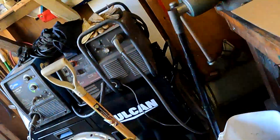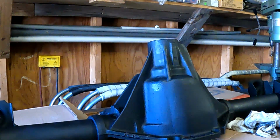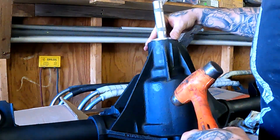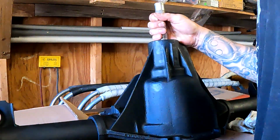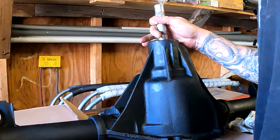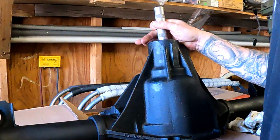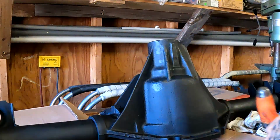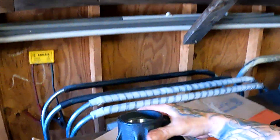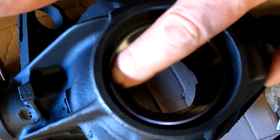So here we go. We'll move over to the rear of our bearing race and the tool. And you don't have to go crazy on these things. Just drive them as needed. Get the bearing squared up. And you'll hear it when they bottom out. There it is. So if you look, that's nice and straight. Same all the way around.